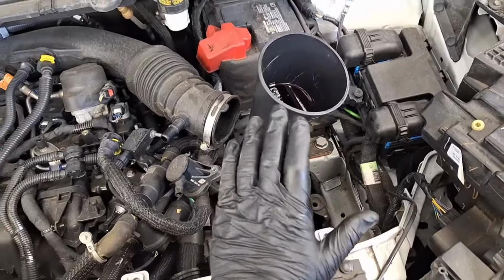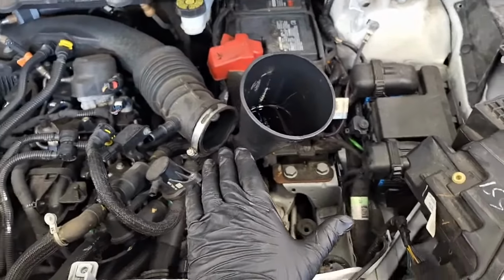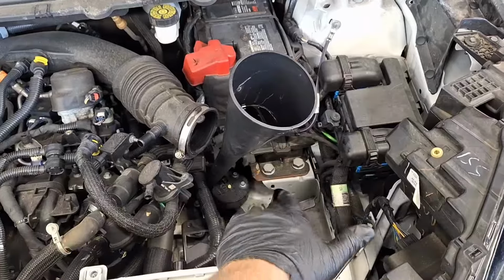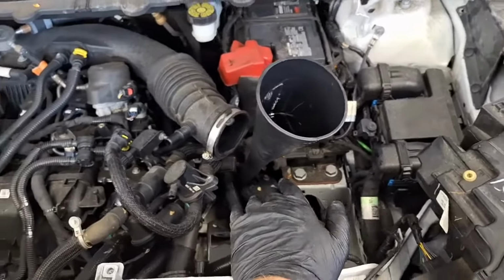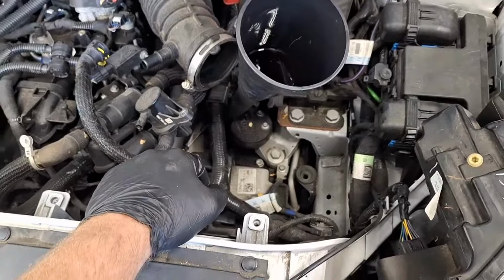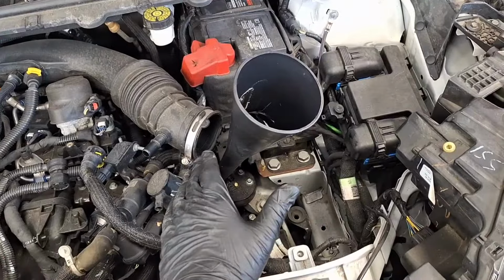Then I'm going to drain it, then put the BG fluid in, the cleaner, with 5 quarts of ULV. Then I'm going to let it idle for 5 minutes. Then I'm going to rev the engine about 20 times and work that cleaner through the torque converter clutch. Then I'm going to run it through the gears. Circulate the cleaner through the solenoids, try to get the varnish and everything out of the shift solenoids and get it all clean, and drain it again. Probably do that 2 or 3 more times. Well, 3 or 4, let's say.